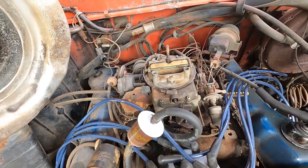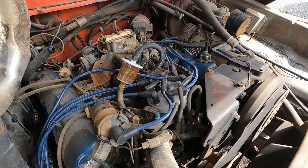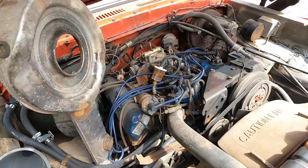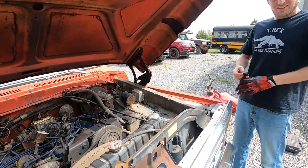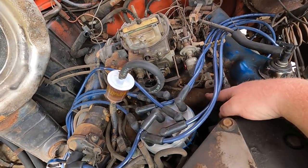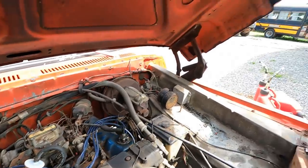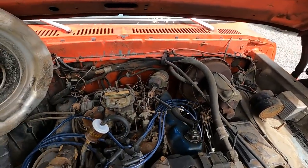And I've heard, and we got D-Daddy, Dan the man here, he's our carb guy. D-Daddy Dan the carb guy. The carb guy, stinky old gas dude. These intake manifolds on the 351 modifieds do not have coolant passages in them. So imagine how hot that fuel gets. Yeah. They say the intakes on these get hotter than the son of a gun. Good thinking, Ford. Preheat the fuel, it ignites in the intake manifold.